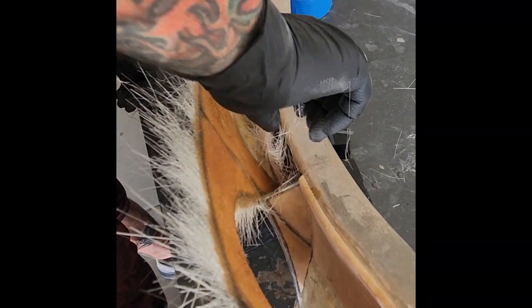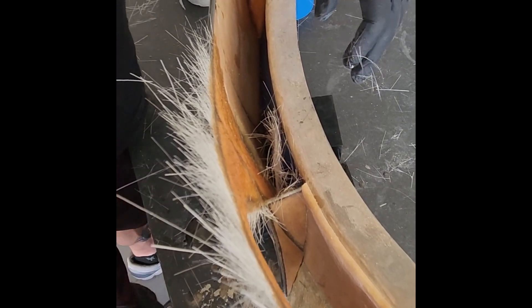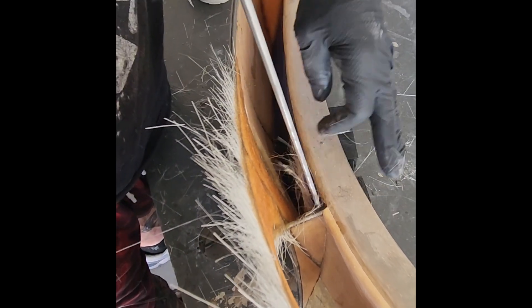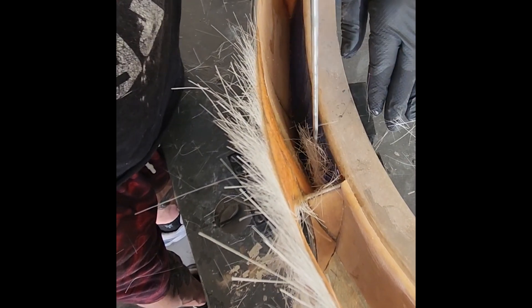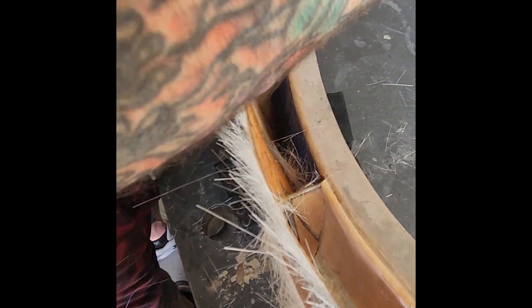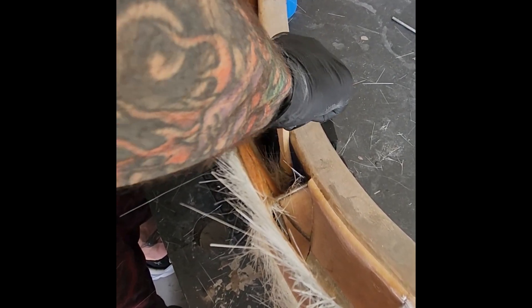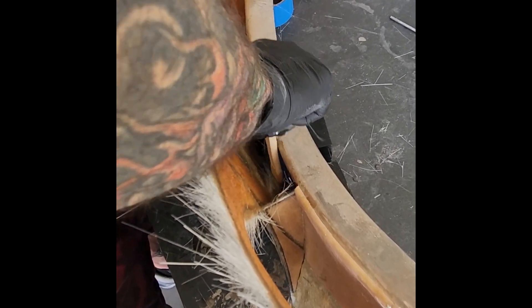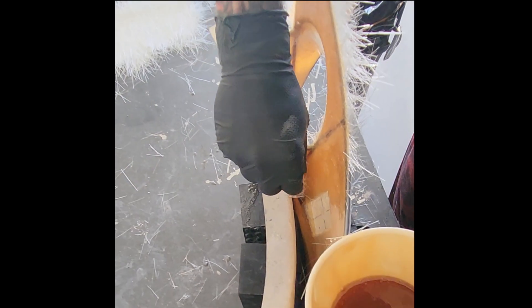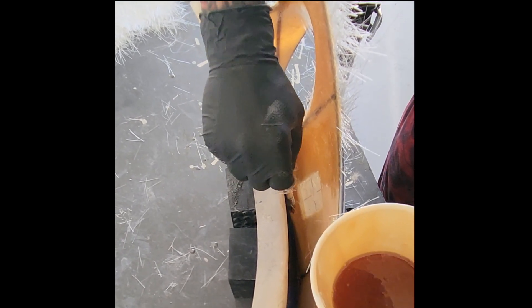Now we're going to get into the actual fiberglass layup for the inside of the panel. It's a little bit different than the outside only in that I cannot make a template and get a full piece. So what you're seeing me do is basically tear small sections and put them into place so that I can fiberglass them. The other thing that's different is on the inside of the panel, I'm having to tie the new fiberglass back into the base panel that I originally made. If you've been following along, you know that when I first did the initial layup for the base panels, after I was done I sanded everything down, so that when I got to this point I did not have to worry about scuffing anything on the inside — it was simply a matter of cleaning and prepping.